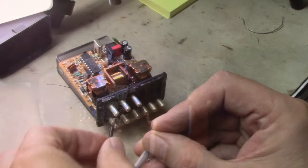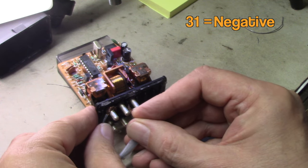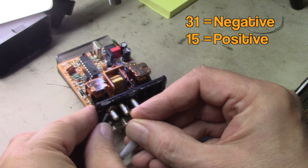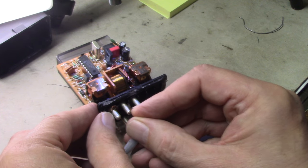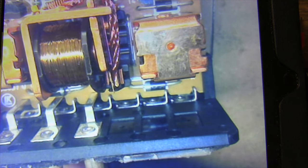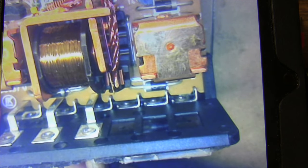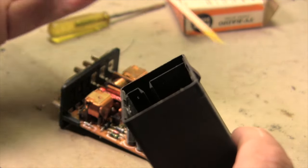Once that cools, I can run a little test on the workbench. If I put 12 volts negative to pin 31 and positive to pin 15, that will pick the relay coils. That smaller coil on the right transfers power to the larger one in the center — that cracked solder joint was making this power handoff intermittent.